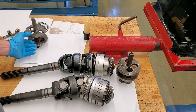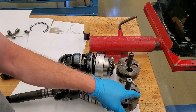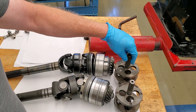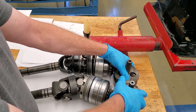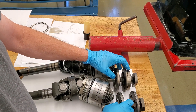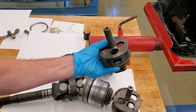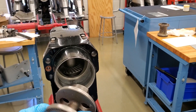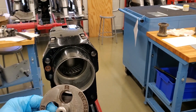I have the new special tool and the old special tool. The big difference between the tools — not just the part number — is the letters X, Y, and Z versus the letters A, B, and C. So two totally different part numbers, and you can see those tools are shaped very differently too, because you have that recess that goes in the case on the newer tool. This is the older case, which takes X, Y, and Z — and again, whatever letter corresponds to your gear ratio.